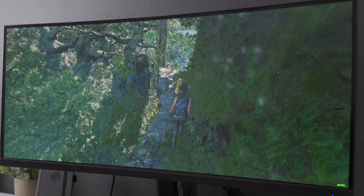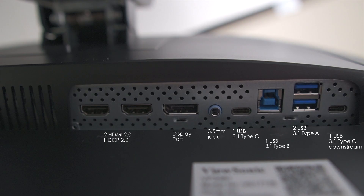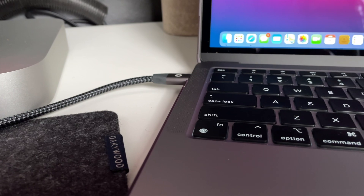When it comes to your external display — whether the Mini, MacBook Pro, or MacBook Air M1 — I had talked about connecting your external monitor via USB-C or Thunderbolt out of the computer. If it is a USB-C capable monitor, you should be able to get 60 Hz refresh rate if your monitor goes up to that, which it probably will. For those with a DisplayPort, you can also connect via a Thunderbolt 3 to DisplayPort cable and still get 60 Hz, as long as your monitor is capable.